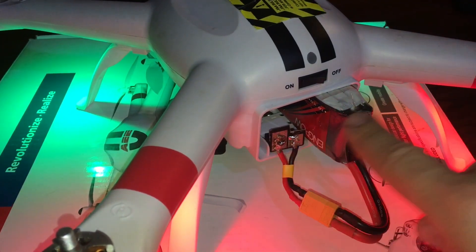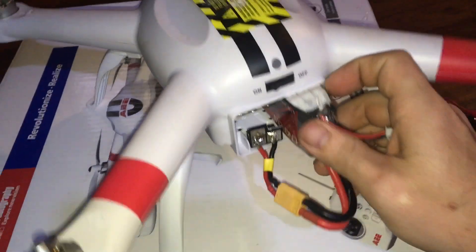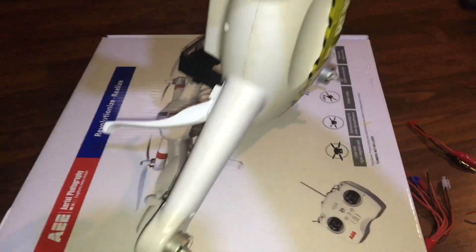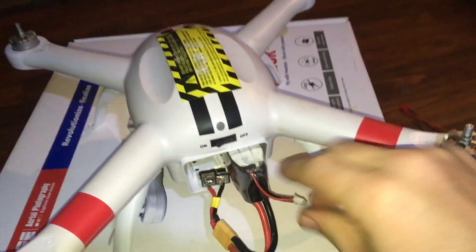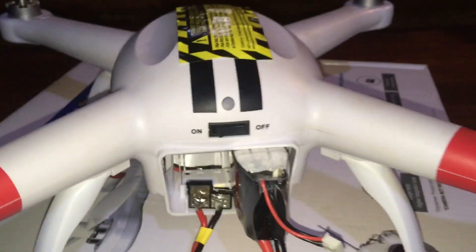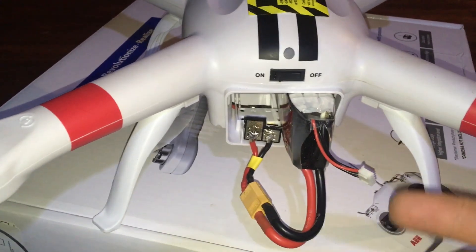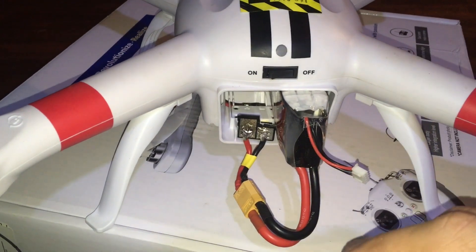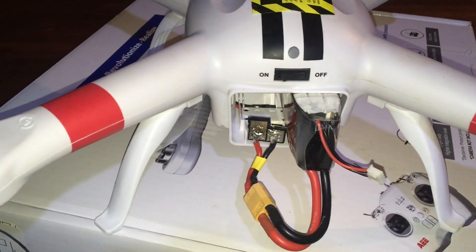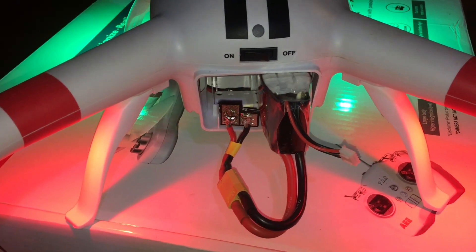You do not need the original battery, because replacement batteries for this drone run around $60 to $100. This is definitely a fix. To make it even more secure, you could run a little velcro left to right, but the battery isn't shimmying out at all — I can lift the entire drone holding just the battery and it stays put. It's a perfect fit. Now I can go buy $30 3S batteries with XT60 connections and just plug right in instead of paying $100. If you haven't subscribed, smash that subscribe button — it works. Any questions or comments, put them down below.